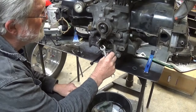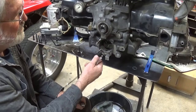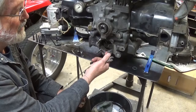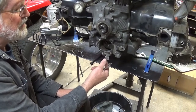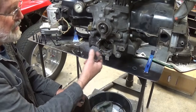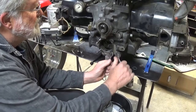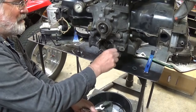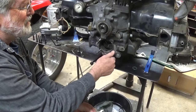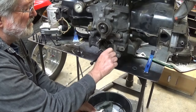I ran these studs all the way through. What I'm thinking might be the solution: instead of using a bolt that you have to run in and out, if I can use these longer studs and get some fresh threads in the back, I'd prefer to go with a stud and a nut. That way I can use any oil pump I want and just remove the nut.